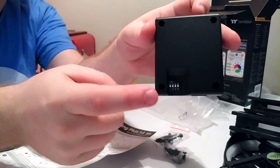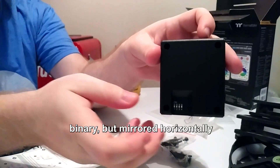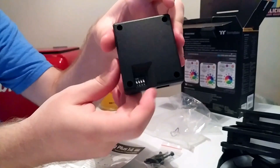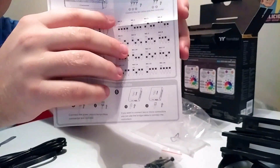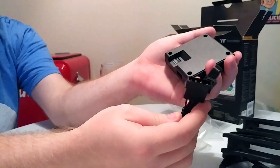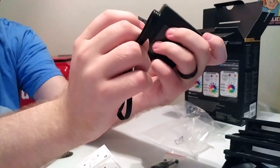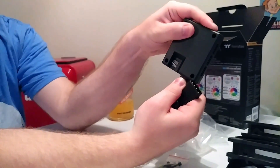If you're using multiple controllers, you have to mess with the dip switches — think of it basically as binary. The controller that shows up as one is configured like this. Controller two is if you move up the dip switch on the far left. Just look at the instruction manual that comes with it; it's all there. In terms of cables that need to be plugged in, you have a four-pin power connector that looks a lot like a floppy connector, which powers the controller, and it goes in next to the dip switches.